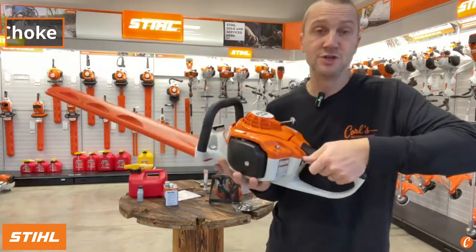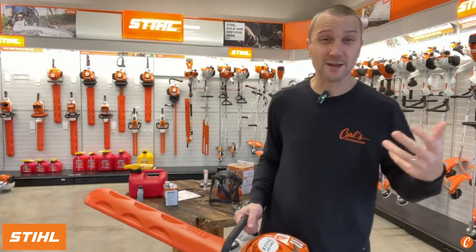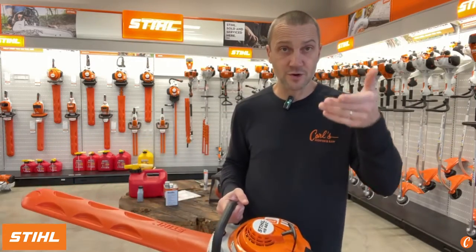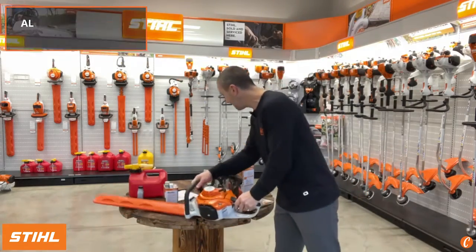Now I'm gonna put the choke on, pull the rope once or twice. It's gonna start. If it's sitting longer, it might take 3 or 4 pulls. Give it its pulls, it's gonna start, hit the trigger, up, squeeze the trigger, it returns to run. Let it warm up, let it sit and idle for a minute while you grab your safety gear.